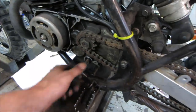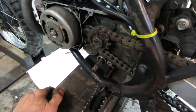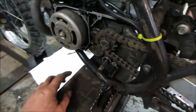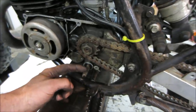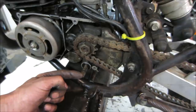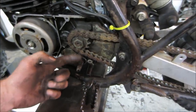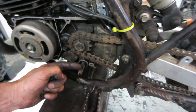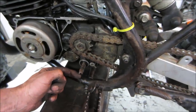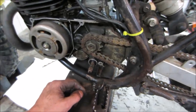I think we're just going to hit it with heat and glue the two of them together with a welder, because this shaft is already shot. You'd have to take the motor apart to change this out. So I think we just go find a happy position that will be comfortable for our foot. We'll weld that on. Later on, if you go to change it, you just come back behind it and cut it with a Sawzall or a whiz wheel. And it's still the same thing. You're not hurting anything. I think that'll be your best bet.